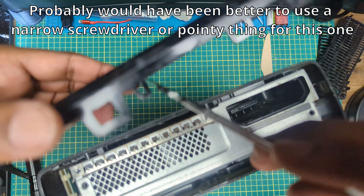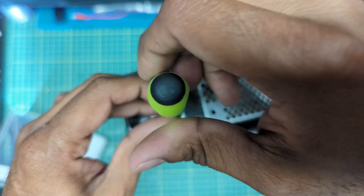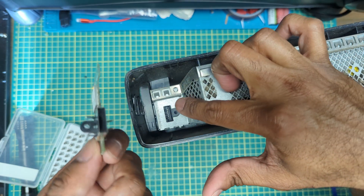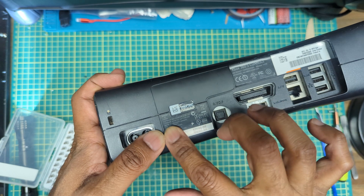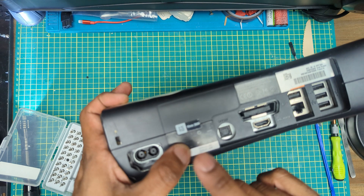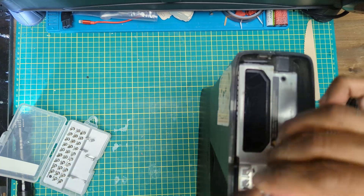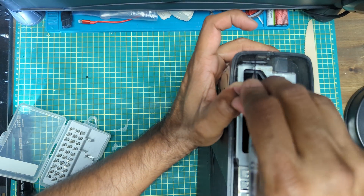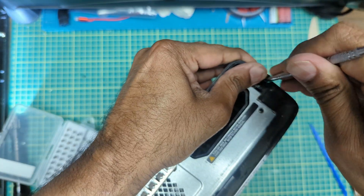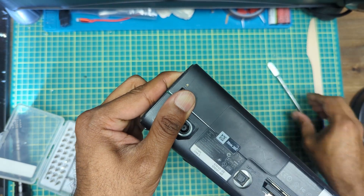Here's why this one is such a pain to remove — it's a lot smaller than the others, harder to stick something down in there. Now we can remove the Wi-Fi card right here, which should just lift out — it's just plugged into a USB slot. Now the fun part: there's a hole somewhere around here under one of the stickers, and you have to shove something in there to release one of the clips. Let's get this clip out while keeping pressure on both halves to keep them apart. One clip down — and where is this other magic hole?